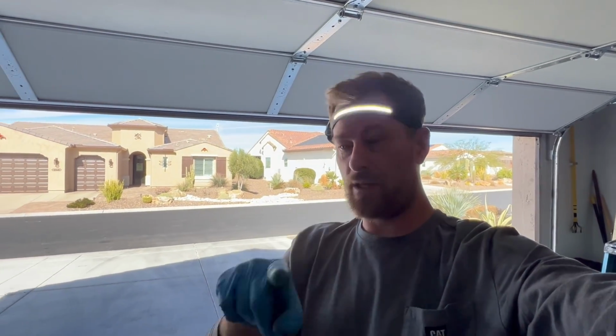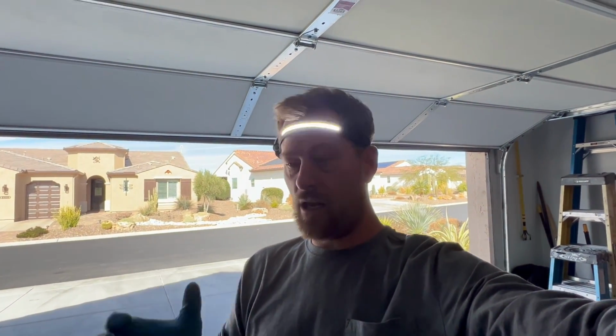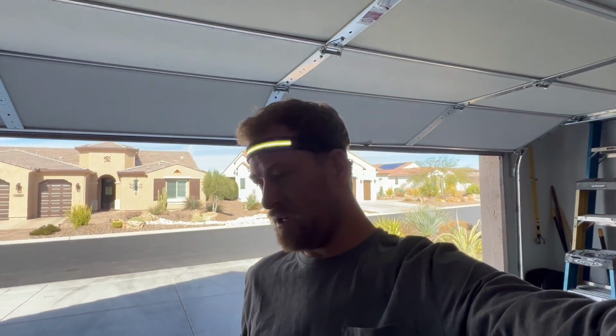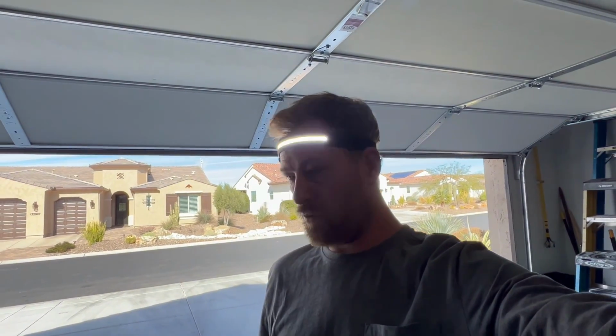One line goes to that line that I just showed you in the engine bay that goes to your brake fluid reservoir, and then another line with a little clip goes to your bleeder block for your clutch. They're both really easy. I thought it would be a little harder than it would have been, but once you know where it's at, it's pretty easy to take off.